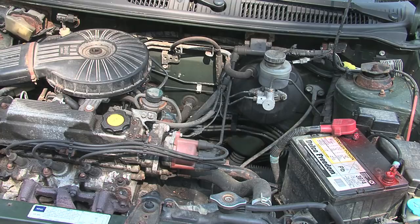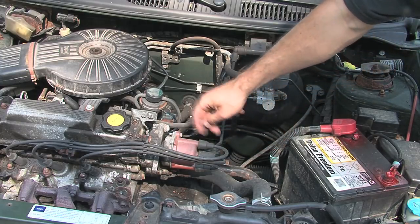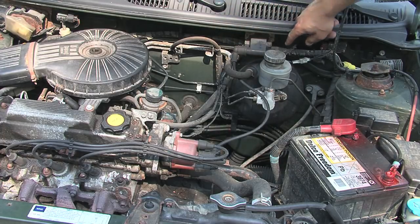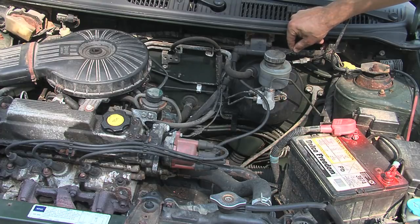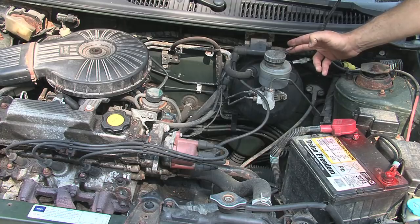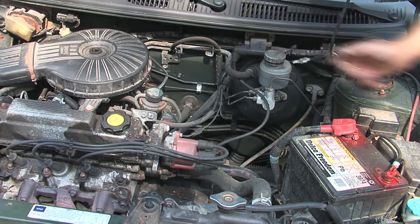While we're digging around under the hood, we should be thinking about how we turn the car on and off. In a gasoline car, spark goes into the engine through the spark plug wires — if we follow those back we see a distributor and a cable, and then some 12-volt wires that only put out 12 volts when the key is in the on position. So if we want a master on/off switch for our electric vehicle, those wires are perfect to use. We'll take out the engine but keep these wires and tap into them for our master on/off switch.